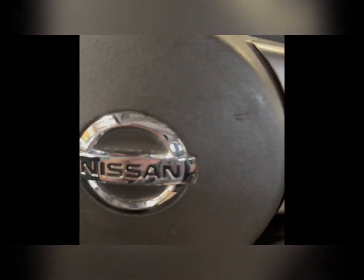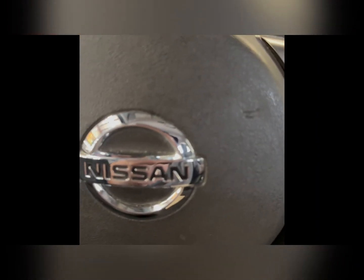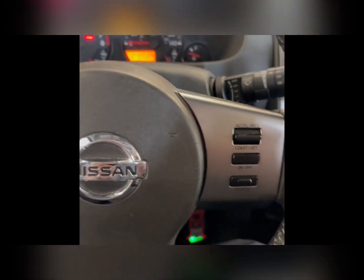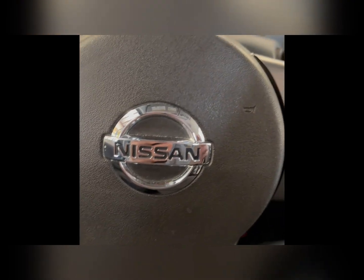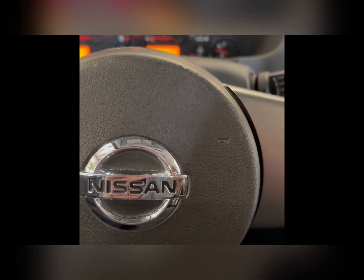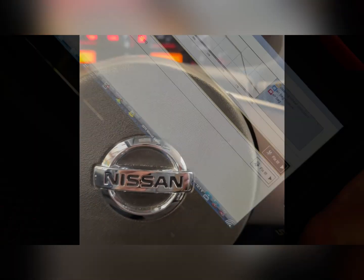So what you're gonna do is hook your scan tool up and get your codes. I already got the codes for this one. Let's see what they were. I have a B1049 and a B1054, both the same description: driver airbag module open.